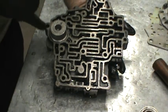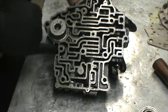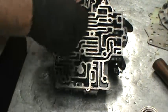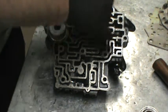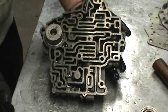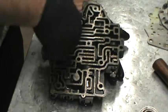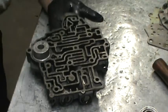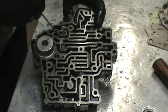There are numerous different valves for your downshift and upshift. The ones you need to be concerned with are: the 1-2 shift, the 2-3 shift, the 3-2 downshift, and the 2-3 accumulator. This area of the valve body is all you need to be concerned with. When you clean it up, you'll pull these valves out — this is where most shift kits have all the modifications. Just clean them out; you can remove them if you want but rarely have to. If it's a really cooked transmission, you'd probably just find another valve body. Clean it out with some cleaner, dry it off, throw some WD-40 in there, and use a small screwdriver to make sure the valves move freely.